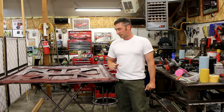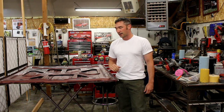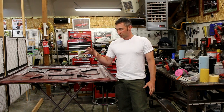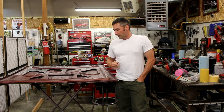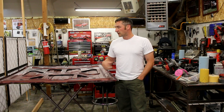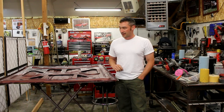This is the one panel I didn't take to bare metal because of all the crevices in the underside of these hoods. It's just a nightmare to get to everything. The paint looked pretty good. I just took it down to 320 everywhere and sanded it off really well, but didn't sand it all off. The paint was too wet when I shot it — the solvents got down in and the paint lifted. You can avoid some of those problems by just going lighter, taking your time a little bit more with the paint so it's not too wet.